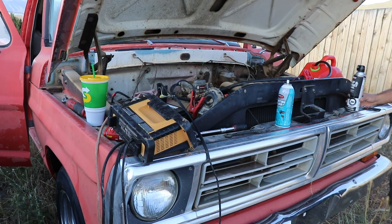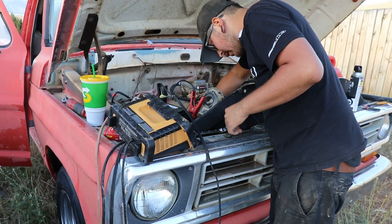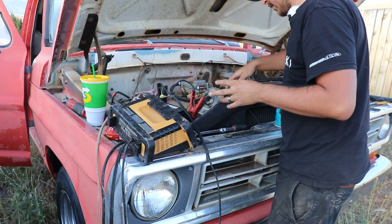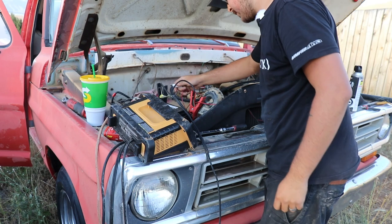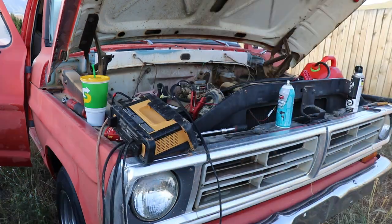All right, that's what I wanted to hear. Now I'm just gonna wire up my pump again, keep it going. Let's see if this will do anything. My suspicion is that this carburetor is gonna be just too messed up to run. I'm probably gonna have to pop that thing off and go through it just to free it up. It seems like it's kind of locked down. So pump's on, let's see what happens.